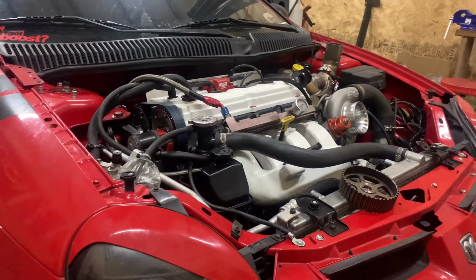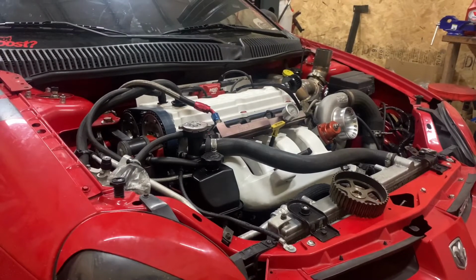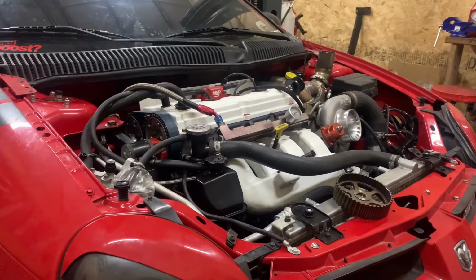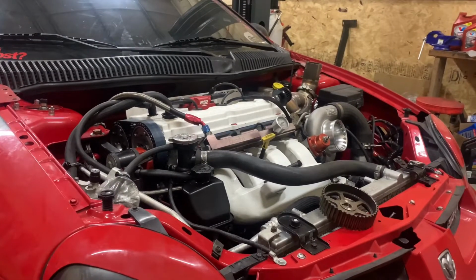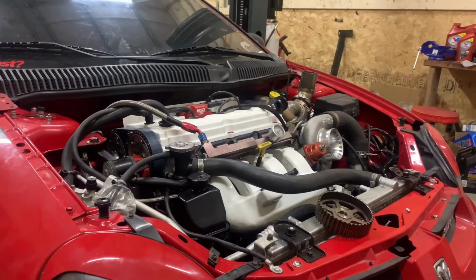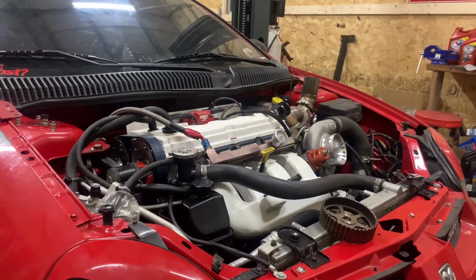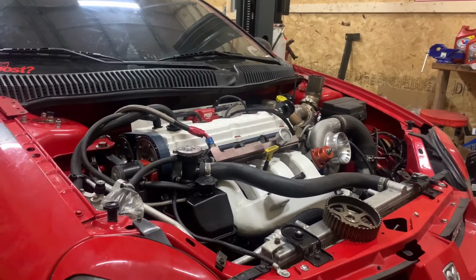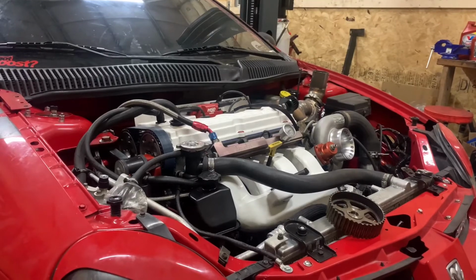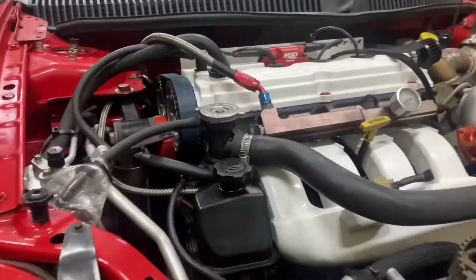And so, long story short, I did a leak down test after I pulled the cams completely out of the car, rechecked timing, everything. I was 100% sure I had a bent valve. That night, I ordered everything, new valves, new head gasket, you name it, just to get the car up and going and meet dyno day. That was originally scheduled with both my tuner and my local dyno.